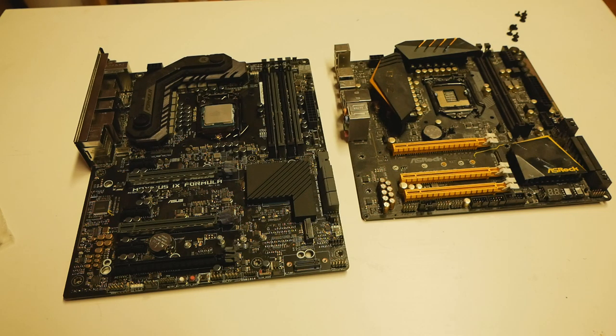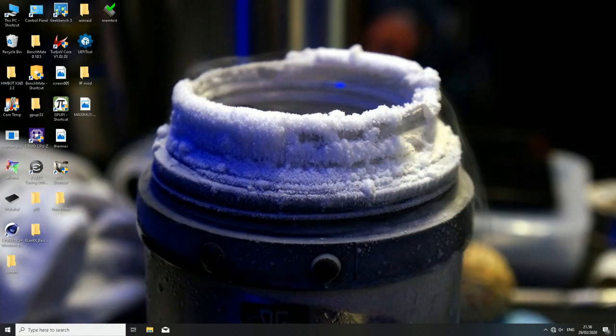So just saying. First make sure what CPU model you want to run, and then you can start with the modification process. So from here, let's get going. I will show you how to modify the BIOS and how to get it flashed onto the motherboard. All right, so here we are on the desktop now, and I will show you how to modify the latest official BIOS from your motherboard manufacturer's website in order to support these newer Coffee Lake 8th generation or 9th generation CPUs.